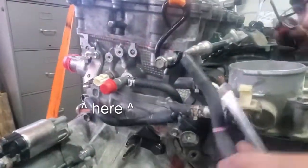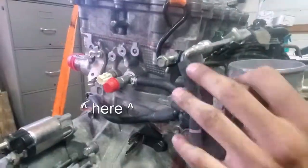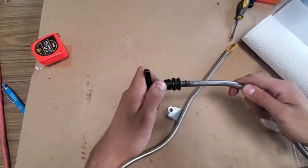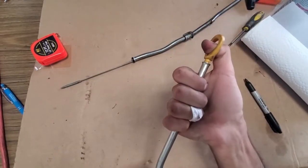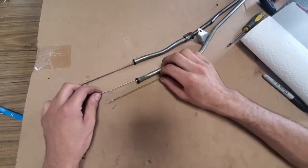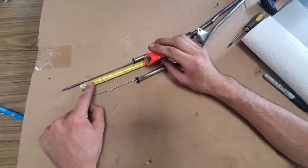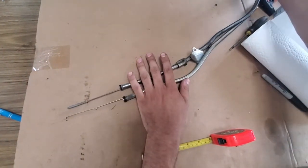The rubber line I had between the engine block and the bypass tube was incorrect — you would only want it hooked up that way if you wanted to race the car, as it would otherwise heat up the throttle body. I fixed this later by connecting them to the proper locations on the throttle body. Next is the custom dipstick. Because the header is in the way, we have to use the MR2 Spider dipstick tube. The tube has to be slightly bent to fit in the oil pan hole, and because of the large bend, you can't use the 2AR dipstick that came with the engine. You can use the 1ZZ Spider dipstick because it's a cable, but it has a different fill line location that's a few inches longer than the 2AR — to correct this, you can mark the correct length that matches the 2AR line.